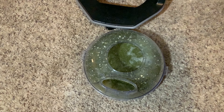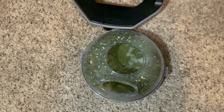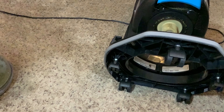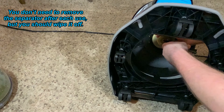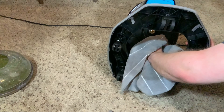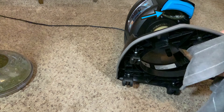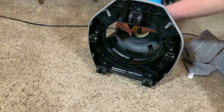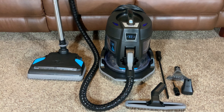There's all the parsley and oats, and I put down some more fake pet hair. You can see how gross the water is again, and it seems to be trapping everything. After you're done cleaning with the Rainbow there are a few things you'll want to do to keep the machine running great: empty and clean out the water basin and leave it to completely dry. Like all Rainbows, the SRX has a removable separator above the dirt basin. You'll want to check and clean the separator as well as around it after each use. Wipe around the big rubber gasket and the oval-shaped inlet, as some debris will cling to them. The separator can be easily removed for cleaning as needed with a handy wrench that stores right on the machine.